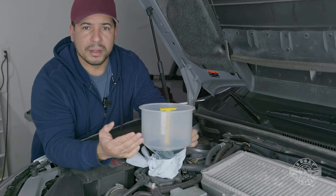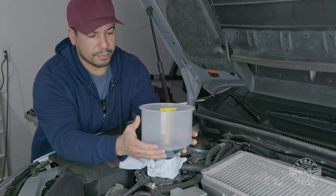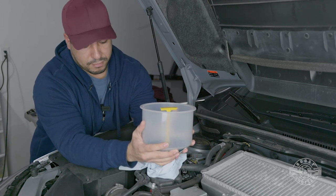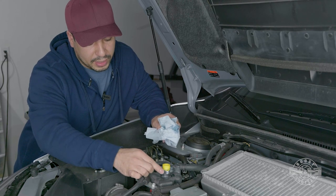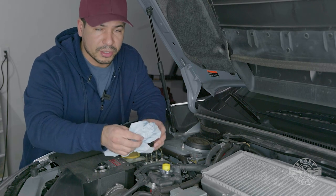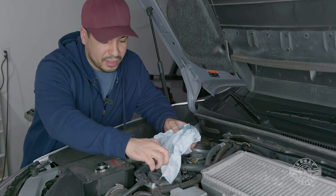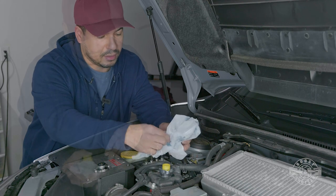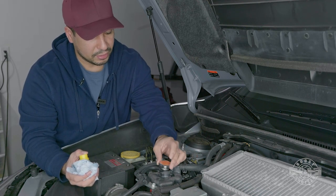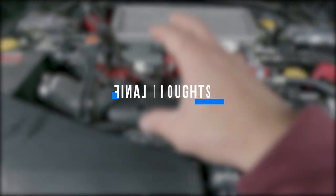When you pull it up, absorb any coolant on the very top so it doesn't spill on you when you take the cap off. Once you get that done, replace the original radiator cap and that's it. Now that we're done putting the car back together and burping the system, it's time to turn the car back on and check for leaks. Before you do, make sure you unpinch that cooling mod hose and remove those hose pinch pliers.